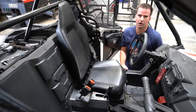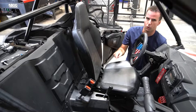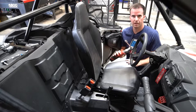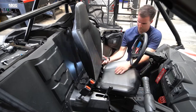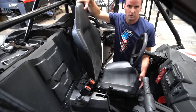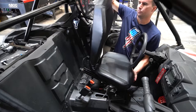First step, you're going to need to remove the stock seat. Start by sliding the seat all the way forward and remove the two bolts that hold the sliders down to the vehicle. For this, you're going to use a 10 millimeter socket and we highly recommend using a long extension on this. Then you're going to need to slide the seat back a little bit to release the two clips in front, then pull it out.